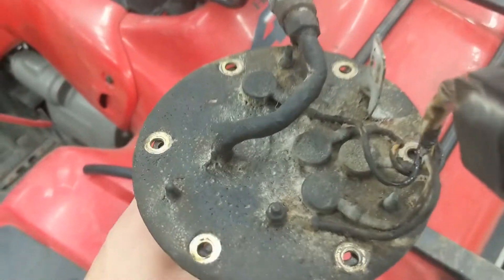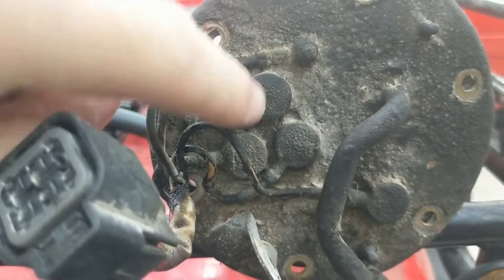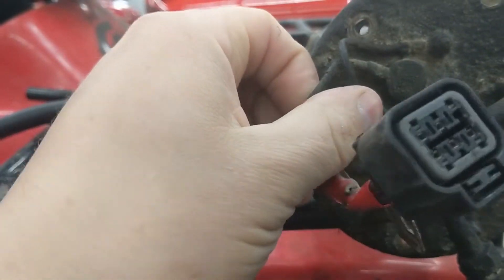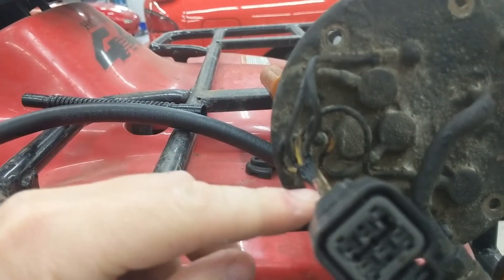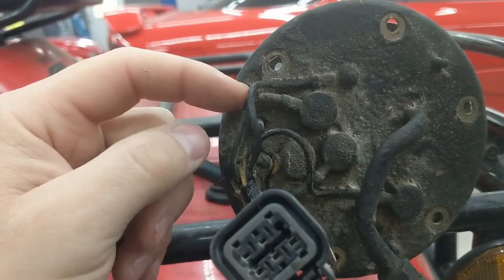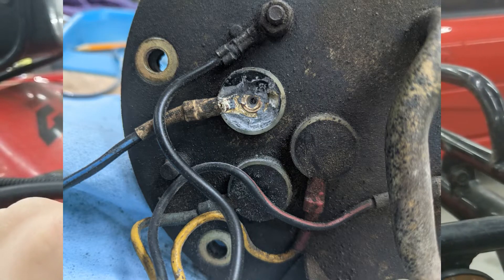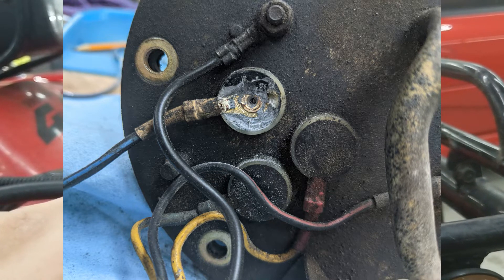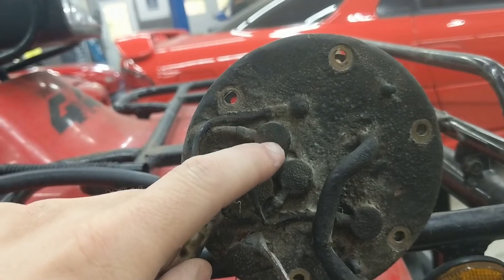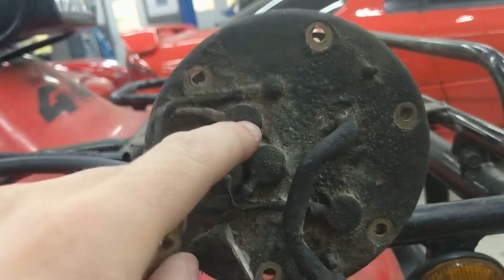For the wiring: there's a bunch of connectors on top — this is the ground and this is the power wire. How my fuel pump was previously hot-wired is I had basically cut the wire going to it, ran the connector side to the hot wire relay to trigger it, and from the thick power wire coming off it I had tied back into the other side of the wire. But I wanted to do a single connection, so I started digging it out — it's like plastic or epoxy filled. I thought maybe Mitsubishi has a nut under there, but it seems to be some kind of rivet or post connection that you have to drill out. You can't reuse the stock stud.